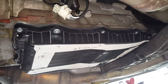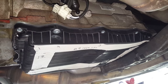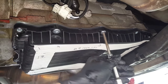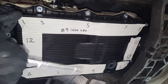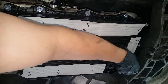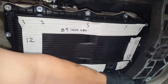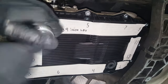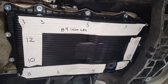All right, so I just got one started here and then here, and we'll just start getting the rest of them in. So once you get a couple of them to hold it, just get them in loosely until you get them all into alignment. And the same way that we're going to torque it, we're also going to make sure that we start snugging it down the same way. So you see the sequence. So I'm just going to continue on